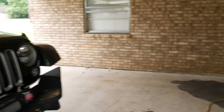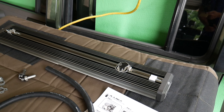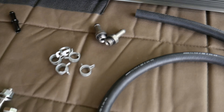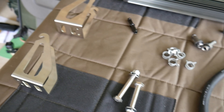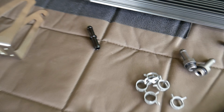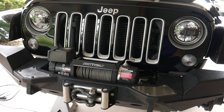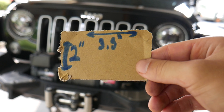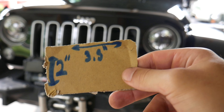Okay, so we've got the tires removed from the Jeep. Over here, let's talk about what all comes with the kit. We've got our power steering cooler itself, some hose, two fittings for the hoses, four hose clamps, two mounting bolts to attach to our mounts, and this bracket piece. Our first step is going to be to remove the front bumper, but first let's figure out where we want to install the cooler. I've made a cutout here that's two inches by three and a half — these are the dimensions of the cooler — so we can figure out kind of where it's going to fit.